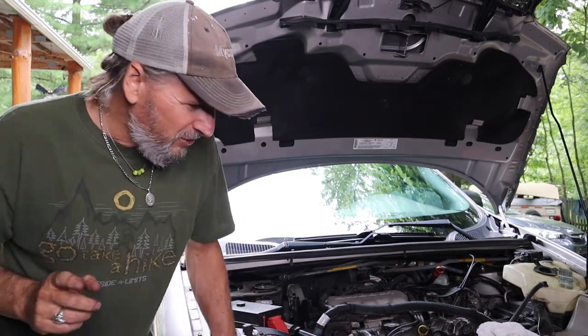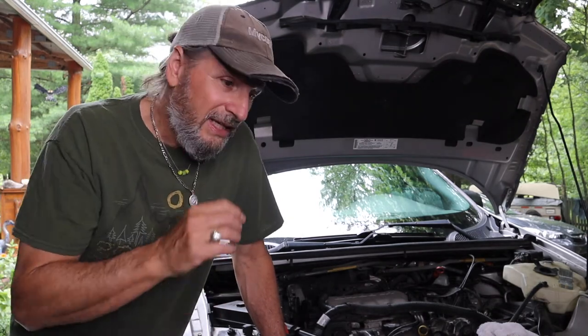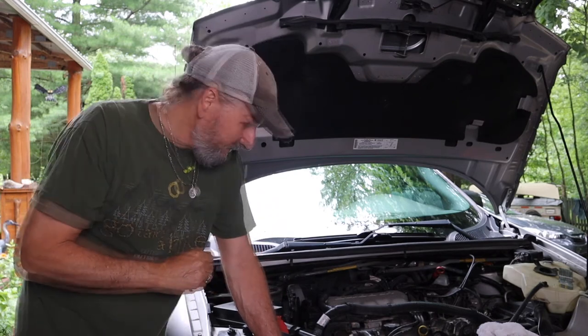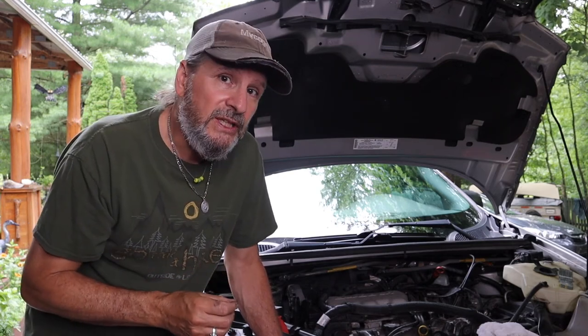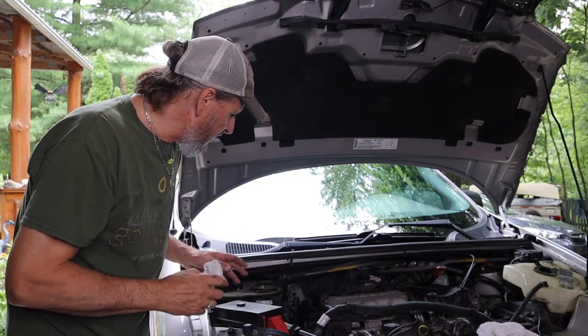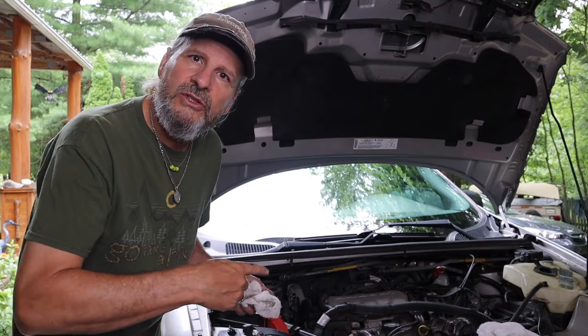In a case like this, I'm going to go ahead and put the tools I'm using in my pocket or side door — just in case next time I'm driving down the road or going through a mountainside in heavy rain and they stop, I'll be able to pull over, get out, fix them, and go on down the road. This is one complicated system. I appreciate you coming to the channel — that's LAF Space Film Fest. I hope this helps you. Remember, be very very careful around this. It would probably be a good idea to go ahead and unhook the wires to the wiper motor so that when you're working on it, something doesn't short out and cause that mechanism to move and get your fingers caught in it.